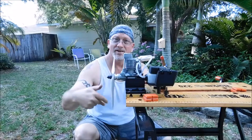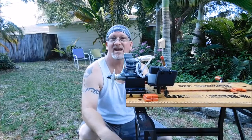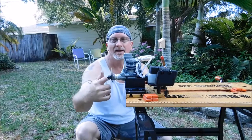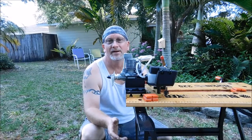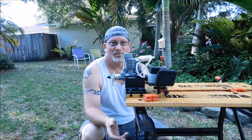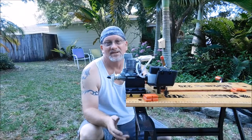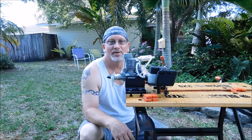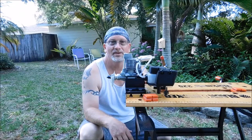One thing I neglected to mention initially is that I have a brand new OS plug installed in that. And this is an APC 12x6 propeller, which from the review I read, the only thing I found on this engine, would be a pretty decent prop for a break-in. So I was getting about 7,500 tops with it because I was going pretty rich with it as a break-in, but we'll see what we can do after that.